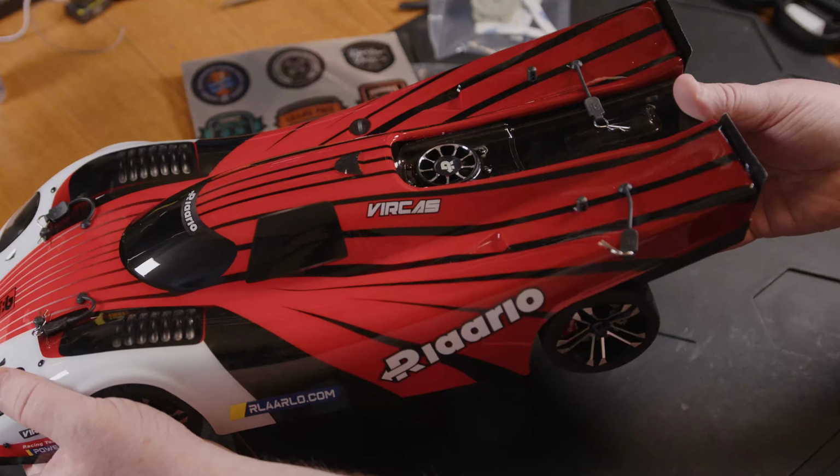If you're going for the 10th size motors, they generally have far higher KV. So you've got two ways you can go with this. You could go for a heavy battery system, a heavy motor and lower KV and higher voltage to try and get your speed through torque. Or you can go for the smaller 10th scale motors, much higher KV. You'd only need to run 2S maybe, or 3S, but possibly 2S if you get the right motor, and you can go down that route. But this has been long enough for a first look, so let's wrap this one up.